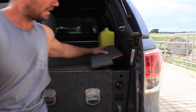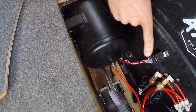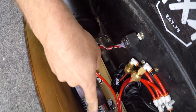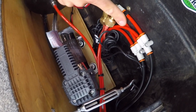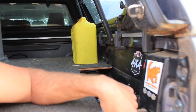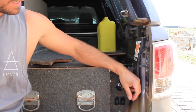Come in here for a look — I'll show you how I've installed it. It all just lives under this side wing in here. If you look up the back, there's the tank, and then you've got the relay here — which you've got power coming in from your battery, power to your compressor, and then your pressure switch goes to one side and your ignition goes to the other. You've got a few three-way joiners in there for your air, a couple of pressure switches — one for each airbag — and then it just goes into your gauge, into your switches, and your outlet. Follow the diagrams and the instructions, easy to fit, and good to go.